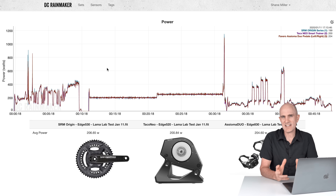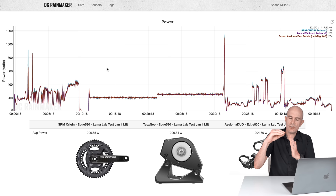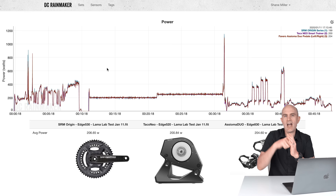Also, the Look Tri-Lobe plug needs a closer look. If you were to screw a pedal into a crank only halfway, it's quite loose until you really tighten it up — metal on metal, it locks in place and is rock solid. With the Tri-Lobe, there's a plug that goes into the crank arm, and depending on orientation you get three different crank lengths. Between the plug, the crank, and the plate is a very small air gap, meaning the interface isn't rock solid — there's always going to be about a millimeter of air gap between the pedal, the pedal plate, and the threads.